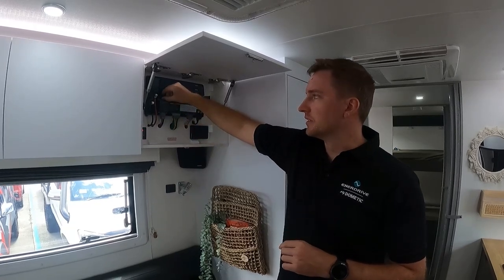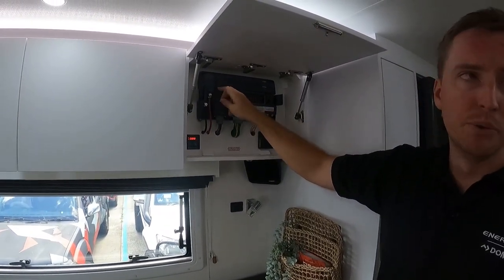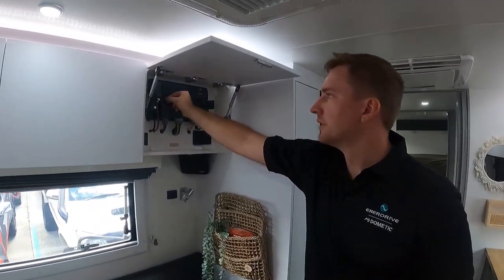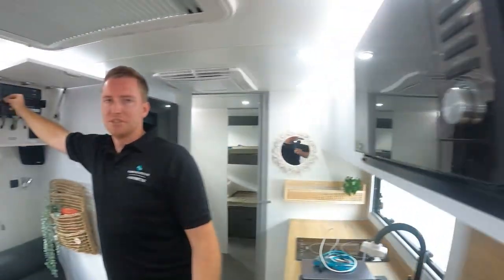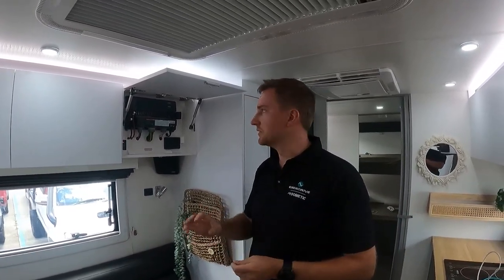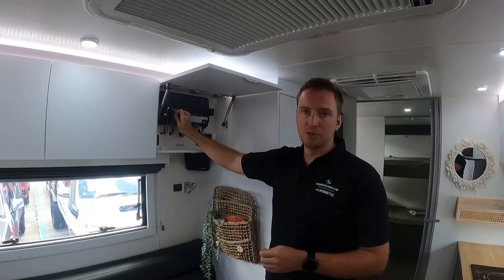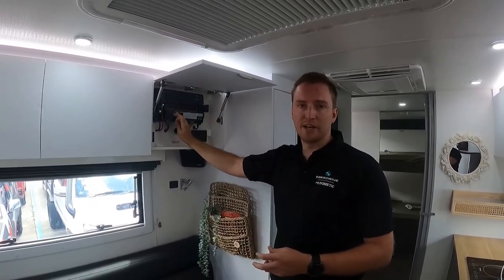It's really nice that you don't have to physically do anything with the fuse. That said, it is really nice to have these fuses here as a hard catch — if you ever had a dead short or cabling rubbed against something and shorted out, the fuse is going to protect the circuit. Now if I pull this fuse out, you can see on circuit two we've got an alarm showing and it's flashing red. Back on the screen you can also see a blown fuse indicator saying the caravan won't operate because fuse number two is blown. If you take that fuse and put it in the upper position, the caravan starts and the screen shows it's in override. This entire unit has a complete override — a get out of jail free card — so if you're stuck in the middle of nowhere you can physically move these fuses to get your fridge, lights, and day-to-day necessities up and running.